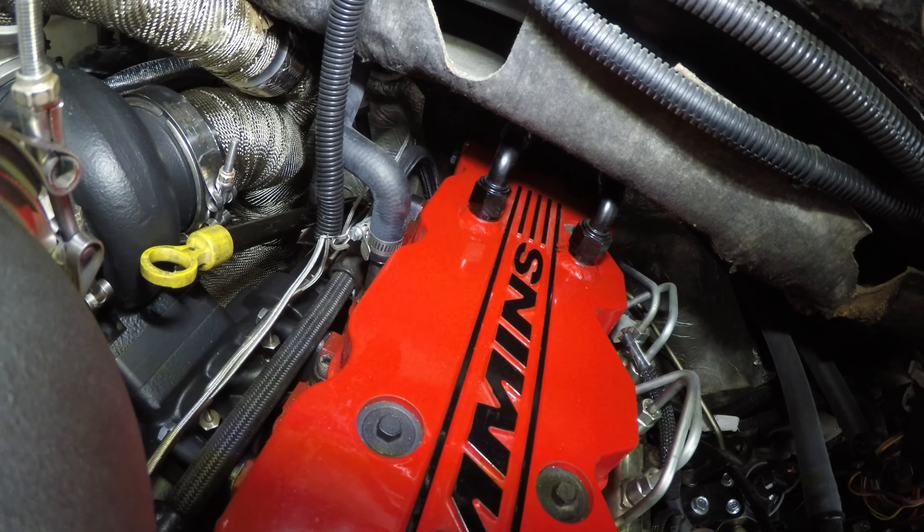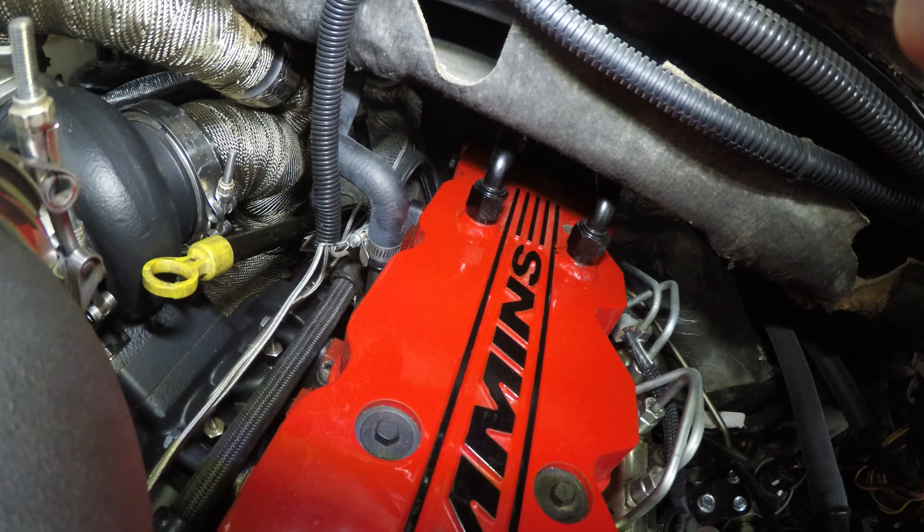There is a bolt on the side here, way in the back — I cut it and put it on there with a gasket. It is a very small breather port; I probably should have just put a plug in there and welded it shut. There's one right behind it too that's open. If you run the Fleece thermostat on the back of the block, it will not work with that, so it's best to just plug it.